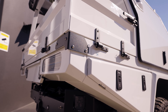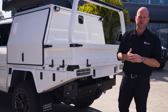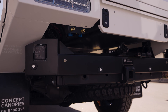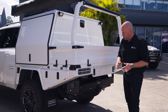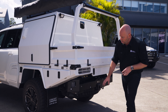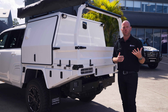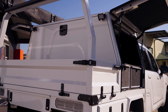As we come around to the rear of the vehicle, I want to show you the importance of this rear ADAS housing that we manufacture here in-house for the 300 Series converted vehicle. The big thing with the 300 Series as opposed to the 200 Series is its ADAS system and how it works between the camera, the rear parking sensors, and the blind spot monitoring. We've created this housing that runs along the back of all GX and above vehicles that not only maintains the correct positions for the reverse sensors and mounts your camera where it needs to be, but also protects the vulnerable blind spot monitoring. These do have a cable that comes out the bottom, and it's really important that's protected — they're an expensive but critical unit, especially when you've got a big canopy on the back.